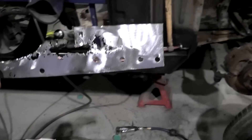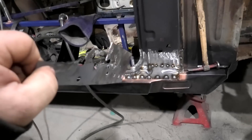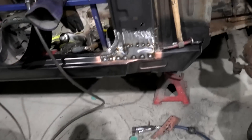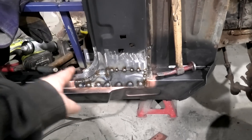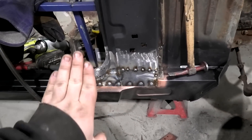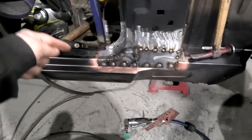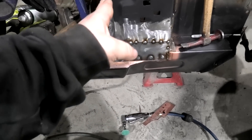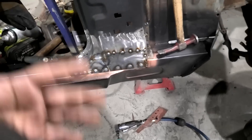This was the Swiss cheese that was in there - wafer thin. One of the tricks is you've got to remember: it might look complicated but it is actually a flat piece of steel. Don't overthink it guys. Flat piece of steel, traced out onto another piece, cut it, trim it, fit it in. I took a little V out of the middle because one half leans over a bit further than the rest. And that's basically almost all of the bottom done in one go. The next piece is just another flat with a curve - just a snip, two lines, drill a hole for a plug weld, and the whole A pillar is fixed.